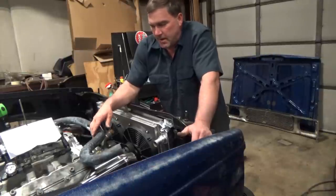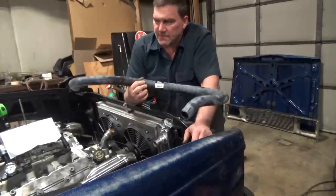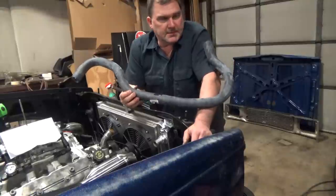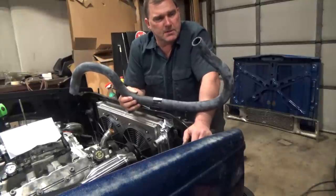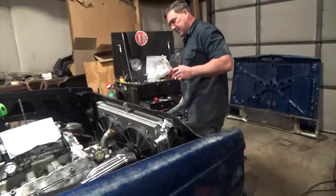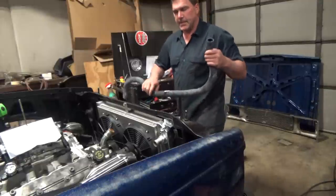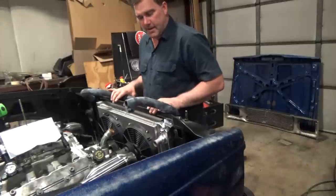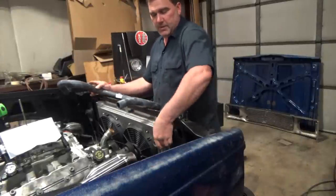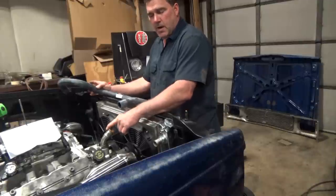So I'm going to try and make one. This is a full-size Chevy truck radiator hose — it's a 22-436 from Gates. It's got a lot of nice bends and it's the smaller inch and a quarter diameter for the upper hose, which is nice. I'm going to take this brand new hose, cut it up into pieces, and make it fit.